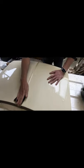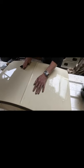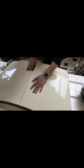The main thing is you don't go right through the paint — if you do, you'll end up back at square one and have to start again. So it's just nice and gently, with barely any pressure. Let the paper do the work, let the wet-and-dry do the work; all you're doing is moving it about, you're the power source. And when you come to ridges or sharp edges, be very careful because you'll go right through, so you've got to be very, very gentle there.